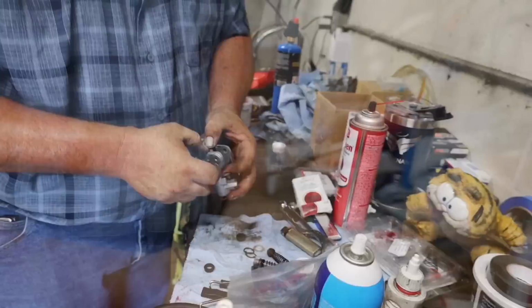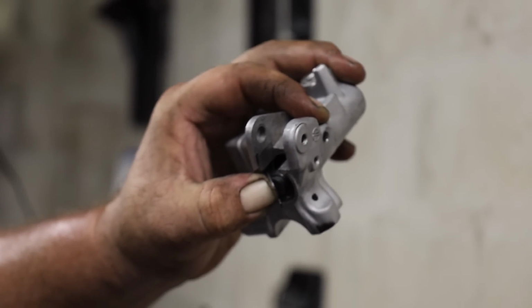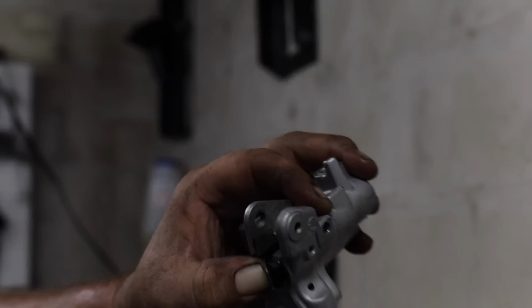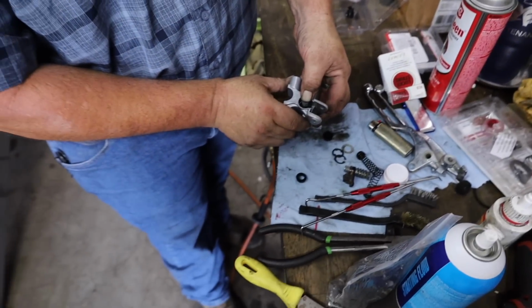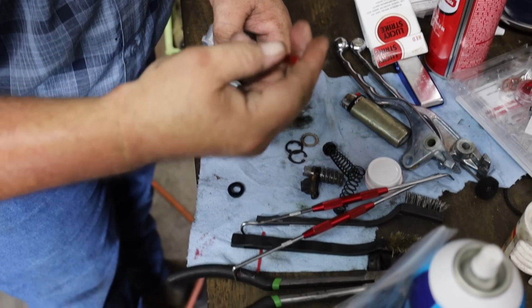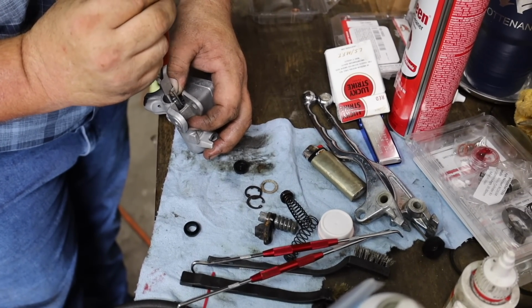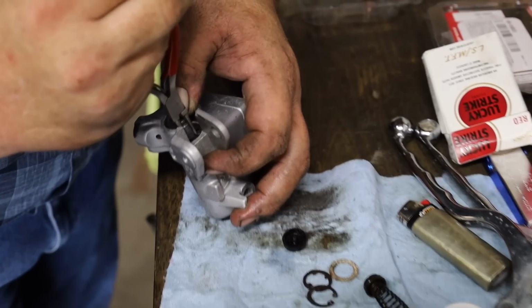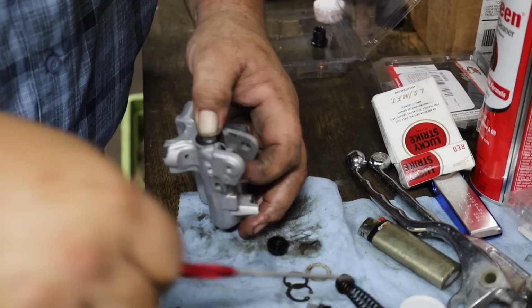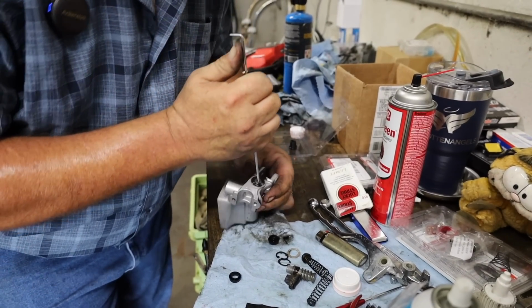We're almost home free. So here's the part that sucks. You gotta get that snap ring, and it's gotta hold the piston down inside the body of the caliper, but you gotta hold the piston down against the spring while you're trying to get the snap ring down inside the body of the caliper. It helps put that on a tabletop to where you can kind of stabilize it, and then use your thumb, or if you have a helping hand or neighbor or buddy or offspring around handy, have them push that down while you're getting the snap ring down in its groove. We're riding the struggle bus right now, folks. I'm almost there. I just got to spin it down and get it caught in the groove.